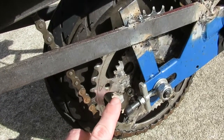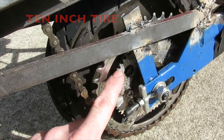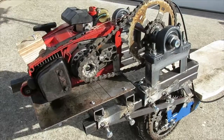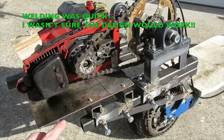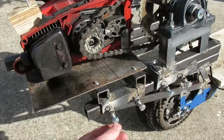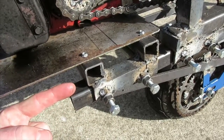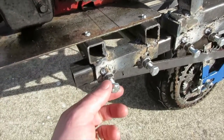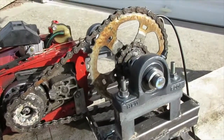This bike sprocket is welded on to the original drive sprocket, which has much smaller teeth. I can adjust the tension of the chains and the position of the motor and the jackshaft, because the motor is on its own platform. All I have to do is loosen these bolts and slide this up and down on this tube right here. You do have to make sure they're quite tight and you do need lock washers, otherwise they'll vibrate free.